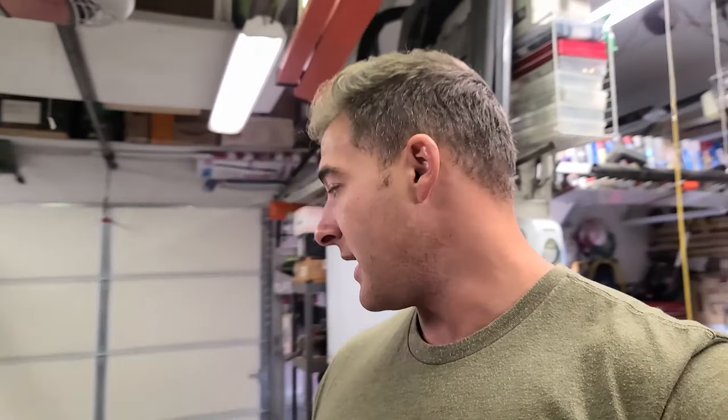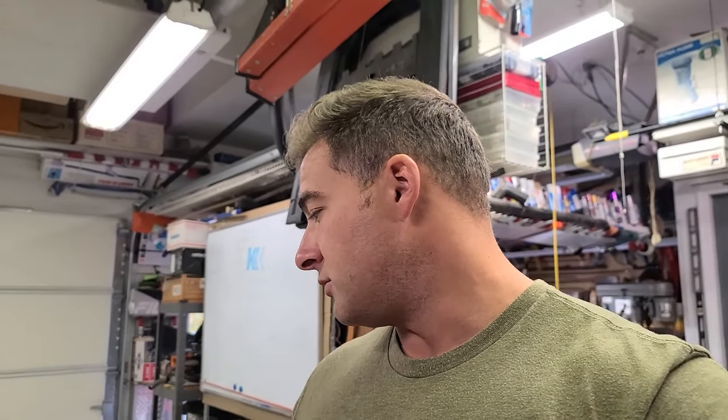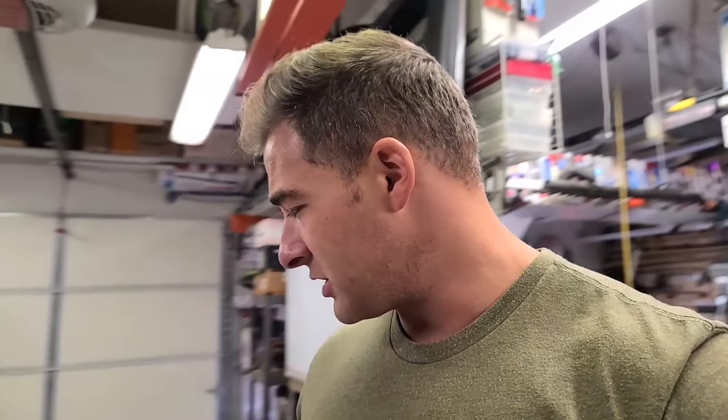So my plan of action is to first get the machine running. We'll put the top end on there, make sure that everything's cool with the bottom end, get the new clutch in there, set up all the cables and whatnot, make sure the wire harness, all that stuff is okay. I just want to make sure that we have a running machine here, because if not, we might have to pull the bottom end and do all that BS. And then we'll move on to all the odds and ends, making it actually nice, taking care of the aesthetics, putting the graphics on there. This shouldn't be that bad of a project. So I say we just hop right into it.